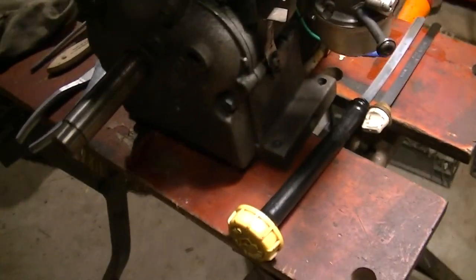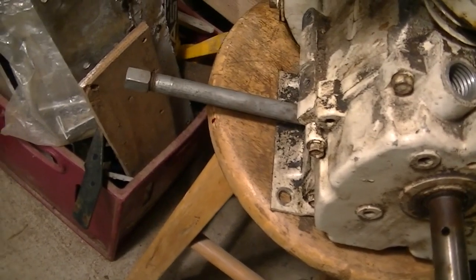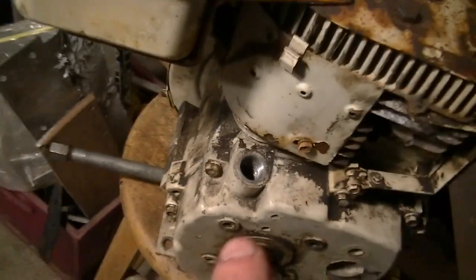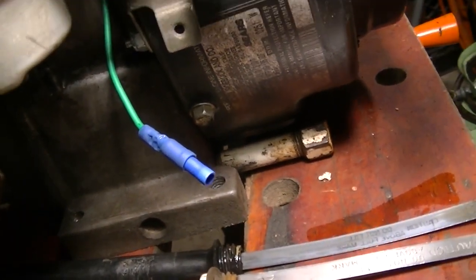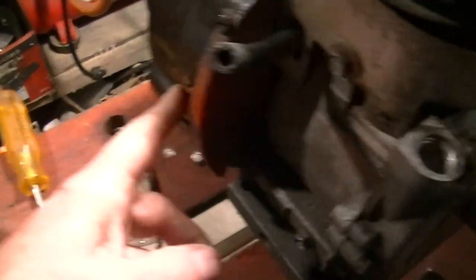Oh, also, I changed out the oil tube because it stuck out too far. It was going right over the rear brake on the mini bike, so I put that one on the old H50 and put that one on there. I got parts from every motor in this thing, because I had to take also this shield here from an H50. I couldn't find that one.